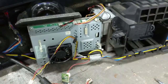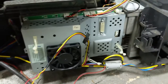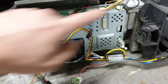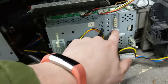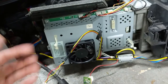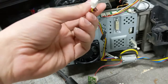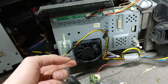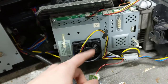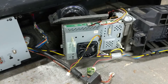After you've disassembled it so this piece is on the ground where you can reach it, remove the screws from the housing at several points as well as these two screws here. That will enable you to take the whole cover off the circuit board, disconnect a little wire, and then unscrew the two screws holding the fan in from the other side. Put in the new one, screw them back in, reassemble it, and you should be in business.